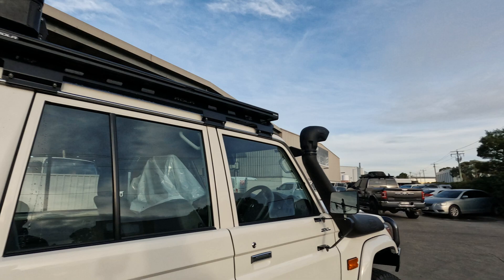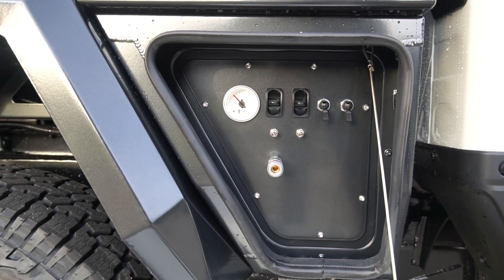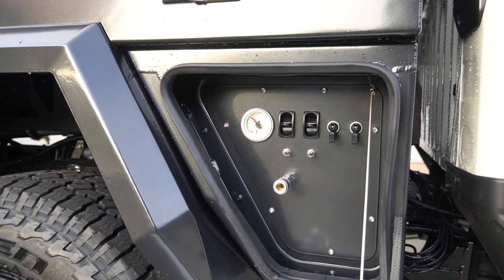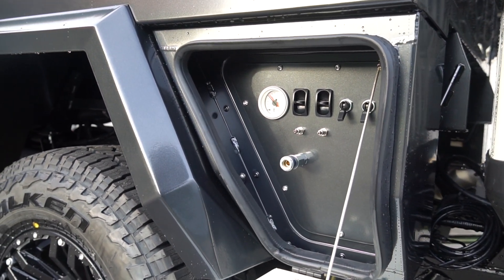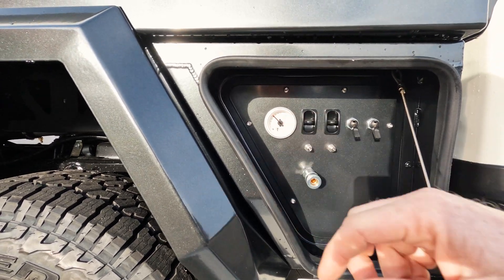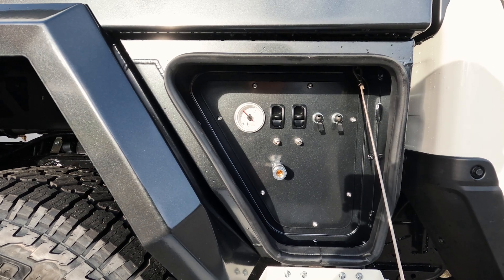Now the air system is obviously plumbed up to the bags that the customer has fitted to this car. We've catered for the air system in this toolbox here — it's got your ups and downs, Schrader valves for each bag so you can fill up manually with an air hose. You've also got your auto levelling kit, an air chuck to go into the tank, and then your gauge for your airbags as well. It's got twin needles so you can see what pressure each bag is running.